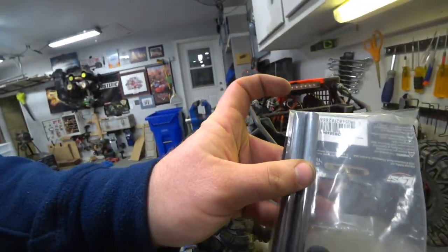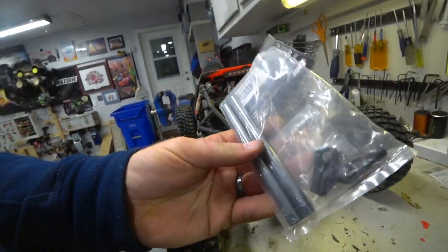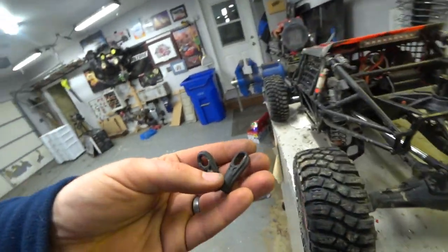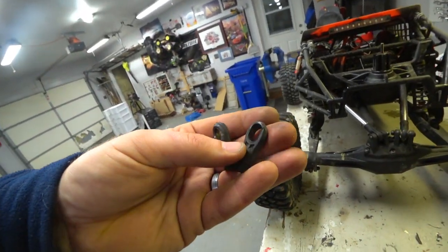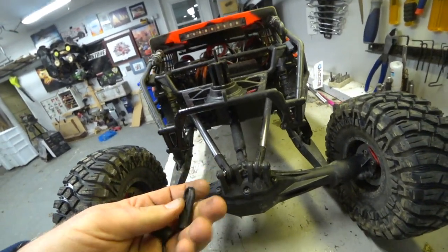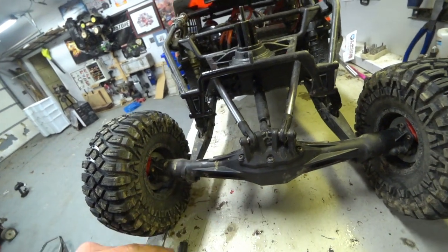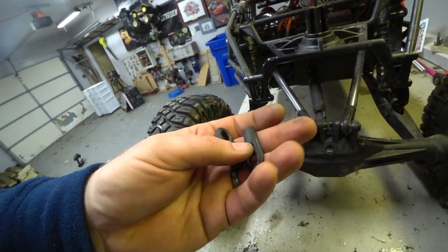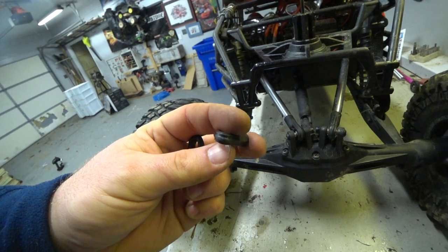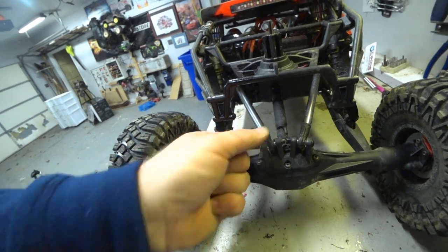The truth is, I didn't need these rods. Look how beefy those things are. If you have broken one of these, you have done something serious. Really, the only thing I needed out of this were these rod ends. The next quest is going to be to look and see — can we just source these anywhere? Are there some aluminum ends just with the right thread pitch and right diameter for the ball that we can use? Does RPM make a rod end for something that just happens to match this? I'm going to try to check through the catalog and try to see what it is that makes that tick — save us a bunch of money instead of having to buy the metal and these ends all together, to just buy the independent pieces.